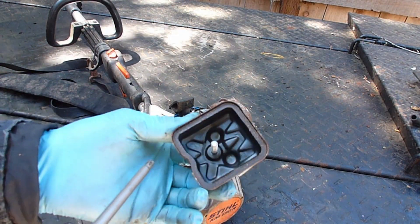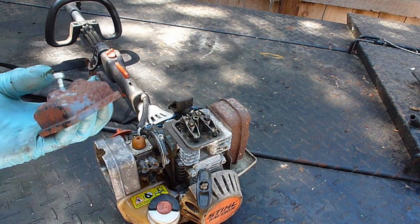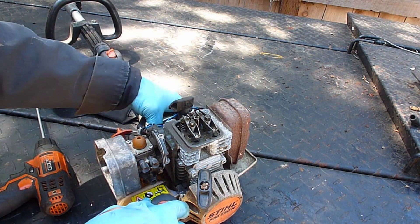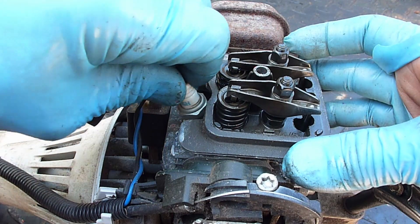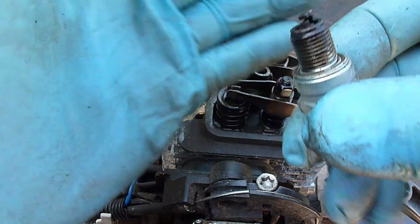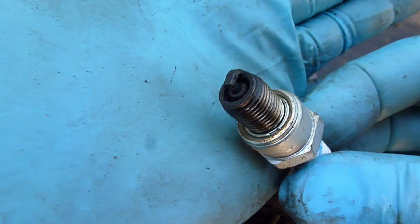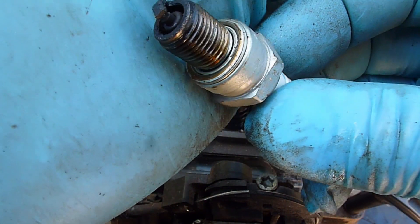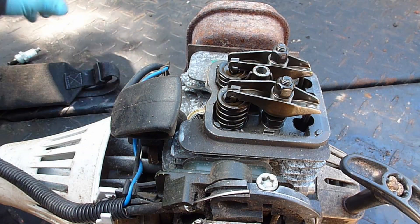The cork gasket is in place underneath this and the copper washer is present. We'll take a peek at our spark plug — this will give us an idea of what condition it was running in on its last run. It's a little dark but looks normal. Much better than seeing a white plug indicating a lean running condition in an overheated engine. So that's fine for now.